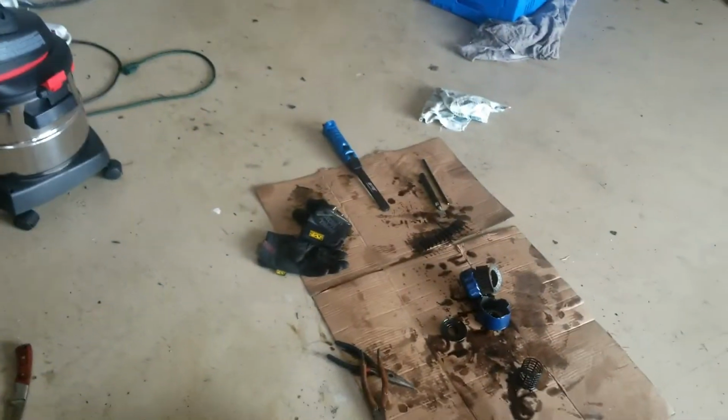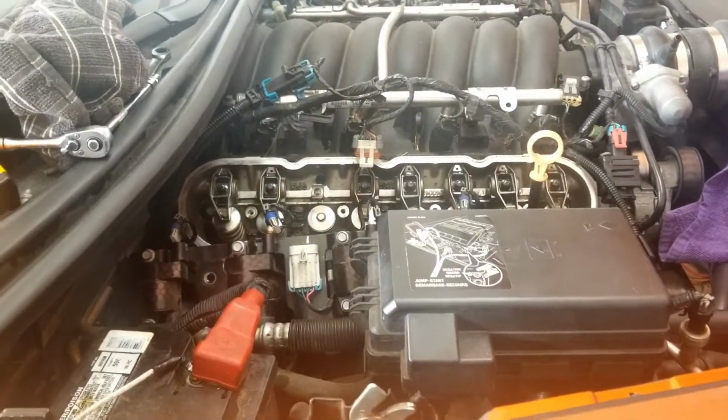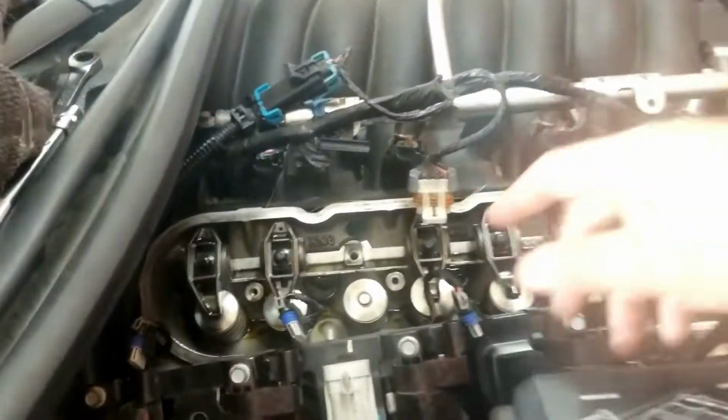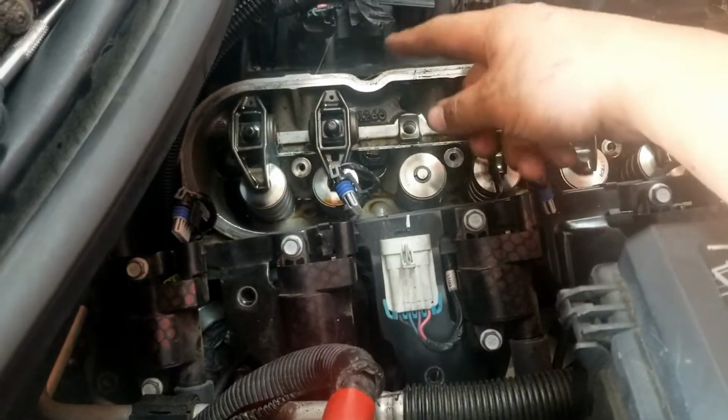Okay, so after talking to Alex, the oil filter and everything kind of looked normal, just the light flaking. So the next thing I'm gonna do is move all this oil and stuff out of the way, and I'm about to start disassembling the cylinder. I mean, removing the cylinder so I can get to this lifter and figure out what's going on.